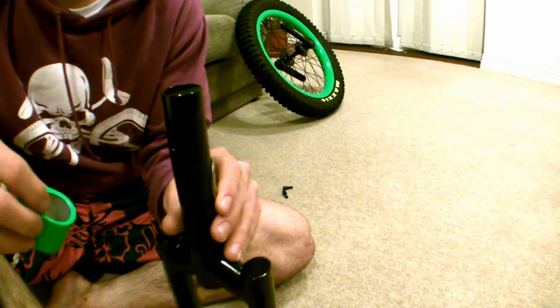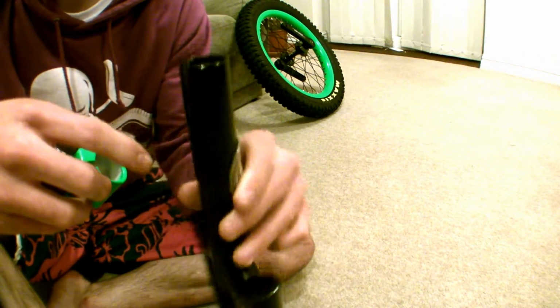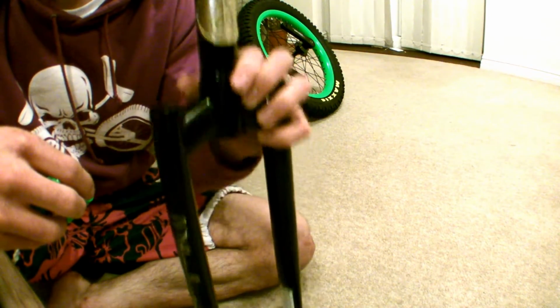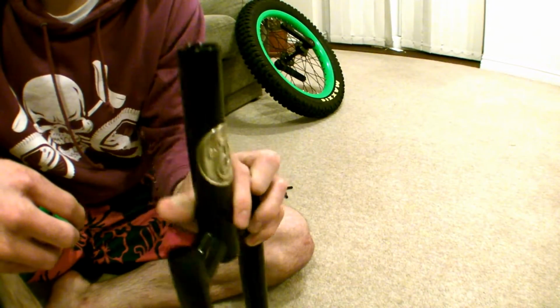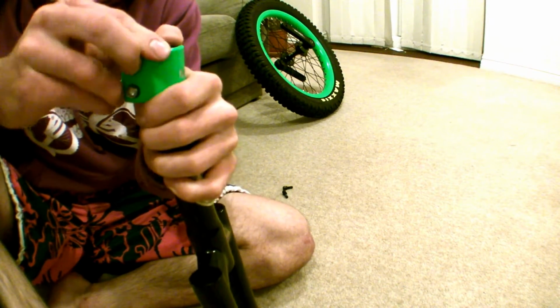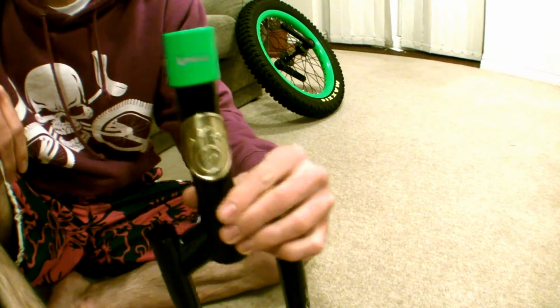So making sure it's the right way up, and making sure the frame is the right way round as indicated by the slot, and the Unicycle.com badge is on the front. Making sure the right hand leg is to the right and the left hand leg is to your left. Slot the clamp onto the frame. They can be stiff because of the paint. If it won't go on, slacken the bolts off as much as they can.